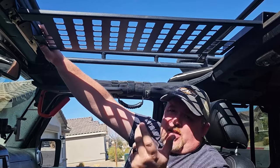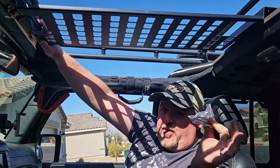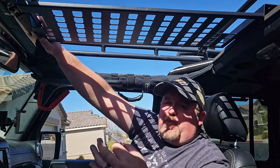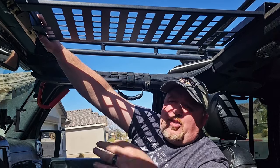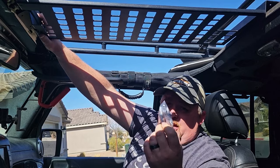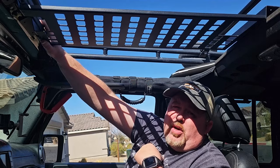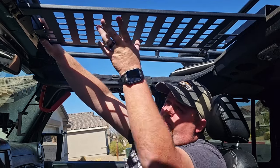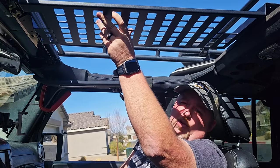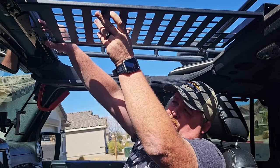The way this thing is designed, it sets right on the speaker bar in the back. It doesn't come with any directions, which is interesting, but it does come with a bag of pop rivets. I don't like things being permanent, because if I decide in the future I don't want it, I want to be able to remove it without making a mess. So I'm going to ditch the rivets and use self-tapping screws — we'll need to drill some pilot holes since we're going into the windshield frame.